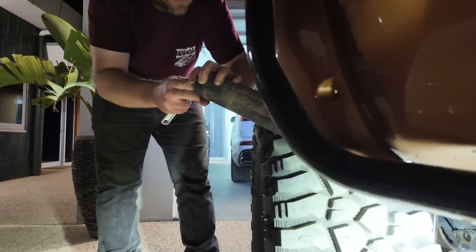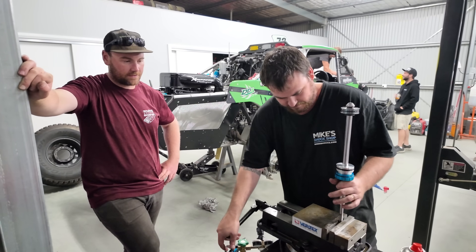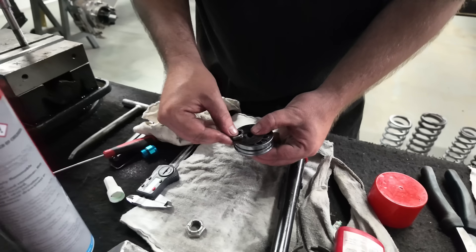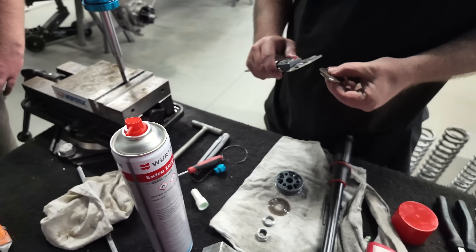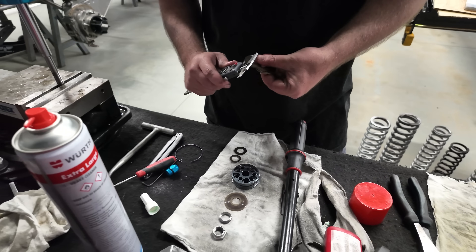Just letting the gas go so we can get it out a bit easier. Braden's just pulling apart one of the front ones to have a look, gonna soften it up a little bit. I've jumped it a few times and I've never hit the bump stops, so it's probably a bit stiffer than it needs to be. It's been great for jumping but I'd rather the ride comfort.